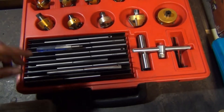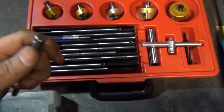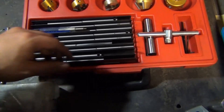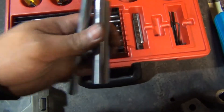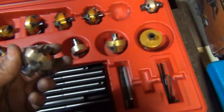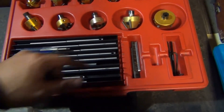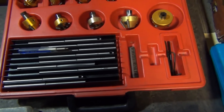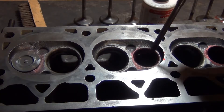You've got several pilots to choose from and these go according to the size of your valve stem — for the Jeep it's 0.312. You also need to choose the handle to turn the cutter and the little extension. I'm going to be using the 45-30 cutter. Besides this there's a little brush to clean the cutter as you're doing the work, and I think we're ready to go.